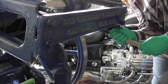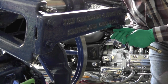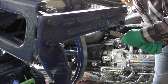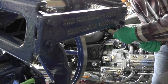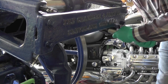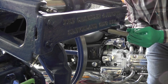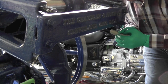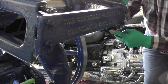Tool is prepared. Shove it over the end. And right now, you can see my little finger there working underneath, trying to get the nail out of the connecting piece. There it is. Nail falls out. Now I can take the end piece, the piece with the cap on it, and push the half inch piece through, compressing the spring using the 3/4 inch pipe as a guide. And there it is, and you see at the very end, poked all the way through.